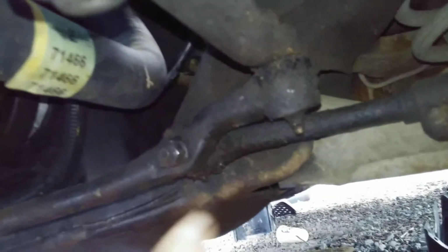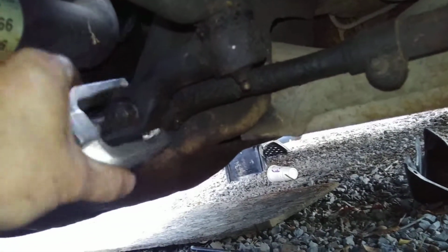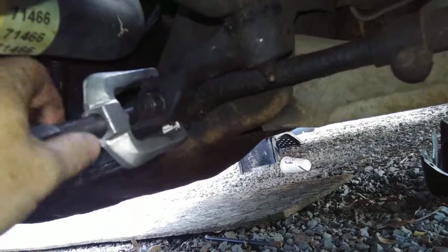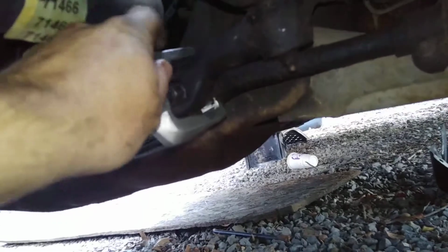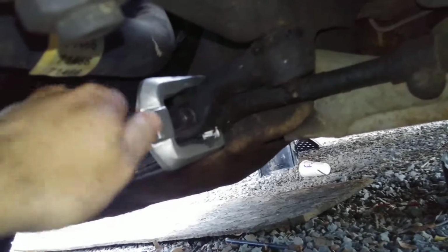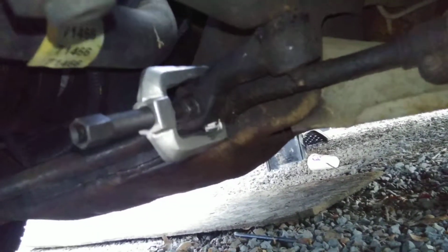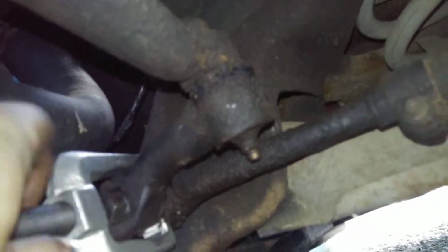That's that one. That's the 18, okay, top. Okay, that's 18. The top's going to be a 19. And then once you bust this nut off and bust this nut off, this is where this little tool here will come in handy. Slide across there and back it out. See, then that'll slide over like that, and then you can tighten this down, and that'll push the tie rod out. And the same way with that there.